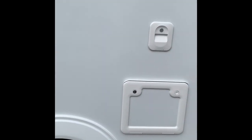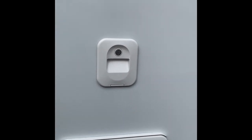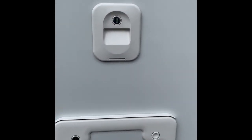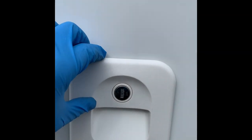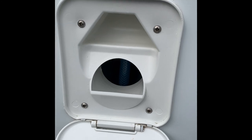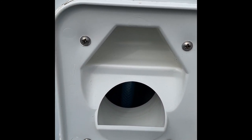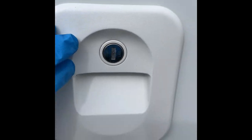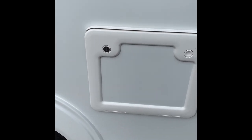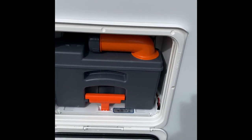I've already unlocked all the bits I can, just for ease of use on this demonstration. Now the really important bit — the toilet area. Your pink fluid goes in here. Check on the bottle of whatever fluid you're using to see the correct dilution levels. Put that in — I just use an old pop bottle and do the dilution there, or use a funnel. The actual cassette itself is the standard Thetford cassette.